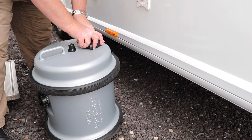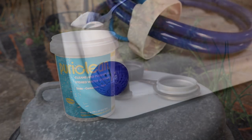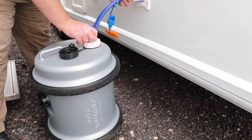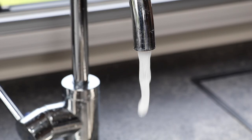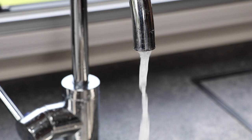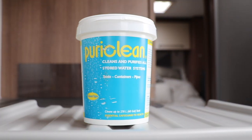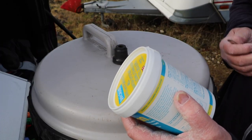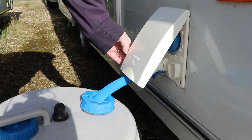In spring I sterilize the caravan water systems, and I do this roughly about once a year. This includes the aqua roll, the fresh water pipes, the water tanks, the taps, and of course the shower water. It's an easy task to perform but it can take some time for the chemicals to do their thing. One important thing to mention is that you shouldn't use Milton — instead use Puraclean, either in powder form or sterilization tablets. I go into more detail about the products, correct dosage, and method in a separate video linked in the description.